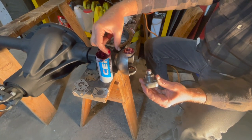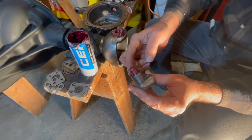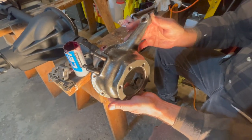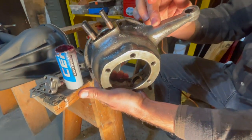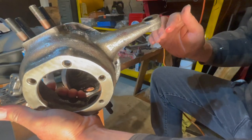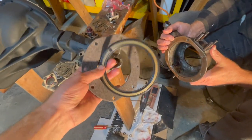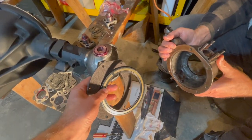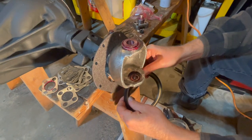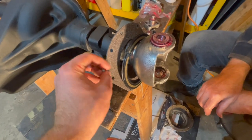Over at the workbench, apply some grease onto the king pin on both the top and bottom — it will fit into the bearings in the knuckle. Make sure you get the correct knuckle on the correct side: you can see this part of the knuckle is offset with a shorter distance to the top, and that faces the front of the vehicle. Important: install your rubber seal and felt for the back side of the knuckle before assembling, because you can't get them on after the knuckle is tightened down. First goes the felt seal onto the knuckle, then the rubber seal — there's a point on the top or bottom where you can slip it on.